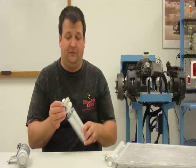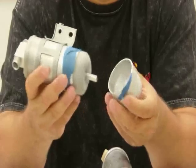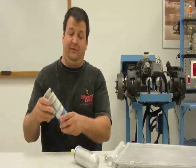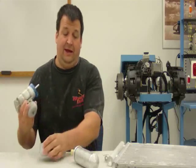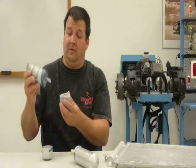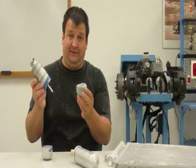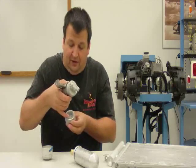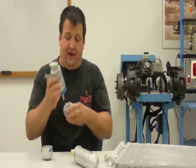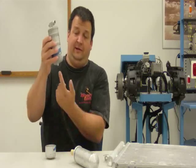The dryer function comes from the bag of desiccant that's in here. I've taken the desiccant out of this one and put it in a bag which I'm going to show you in a second. But on this dryer I've left it intact. This is what the desiccant bag looks like, and you can see it's a little bit black there from the refrigerant flowing down through the desiccant bag before it sits in the bottom of the can to then get sucked up the tube and go on.